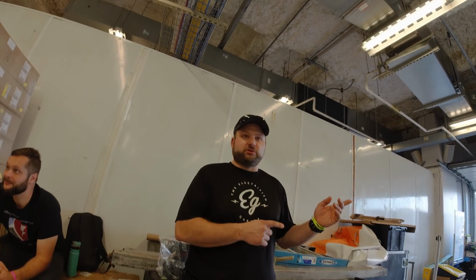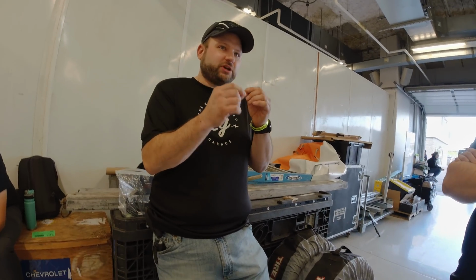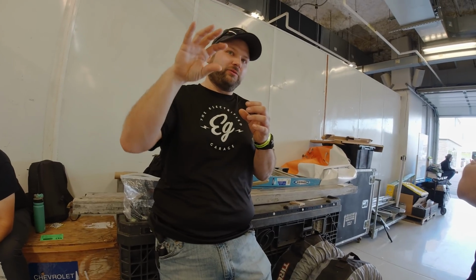So in that powertrain, you have an inverter. You have an inverter converting DC back to AC to the motor. So not only do you have the motor getting hot, but you also have the inverter getting hot. Yeah. And a Model 3, it doesn't take much for that to heat up anymore. Well, half the power is being created by the permanent magnet, so they don't have to create it. It's almost a magnetic perpetual motion, because you have one magnet creating current, the one that's not being fired, to feed the other ones that are being fired. Oh, I see. So it takes significantly less amperage, less heat.